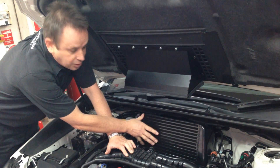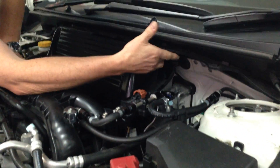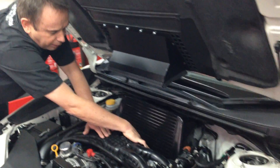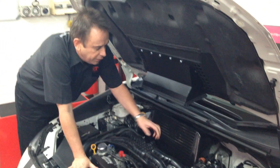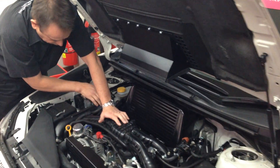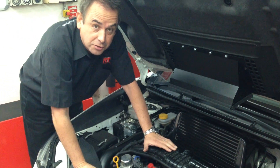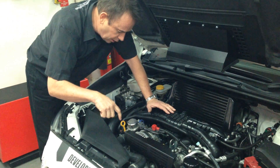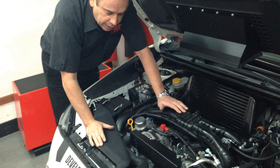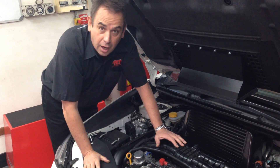It also allows a much larger, more efficient intercooler to be fitted. If you look from the side, it's actually a lot thicker, and it fits just underneath the scuttle to get the maximum size possible. Down the bottom, you can see it just clears the factory clutch slave cylinder for the 6-speed transmission models. If you've got a CVT transmission, that is not a problem. The kit comes with all brand new silicon hoses and a really cool hard pipe kit that goes around the side — remember, this engine's got the turbo right down the bottom now. It fits with all the original factory airbox, and the hard pipe kit between the engine and the back of the radiator replaces the original factory parts quite neatly. It comes with all new connector hoses as a complete kit.